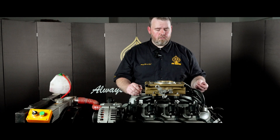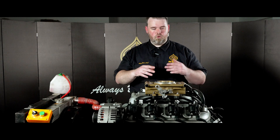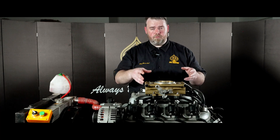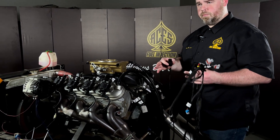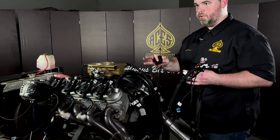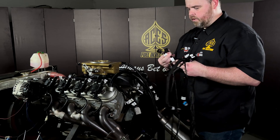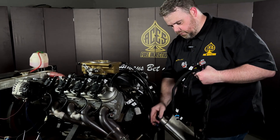We're set up and ready. We're just going to do some final touches on the harness install, show a few key connections, and start this thing up. This is going to be LS throttle body with the ability to do trans-control and full tuning capabilities, so if you want to get on your laptop and dial this thing in, you can — you don't have to dial in subsystems separately. Battery positive and negative are connected directly to avoid transient voltage. We've got wideband number one — since it's a throttle body, we're only using one Bosch LSU 4.9 wideband O2 sensor. We just click it right in place.